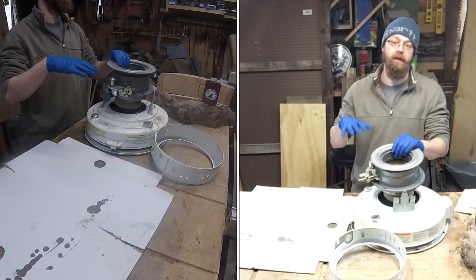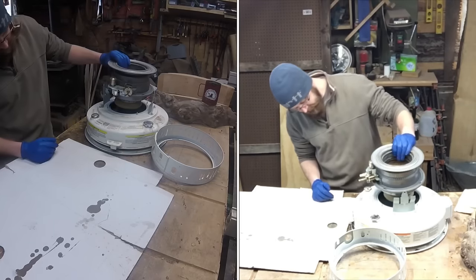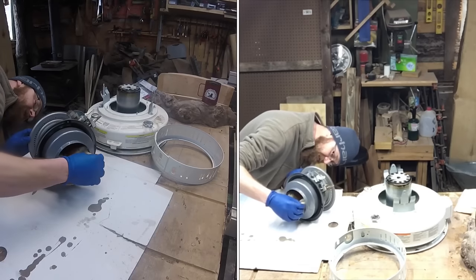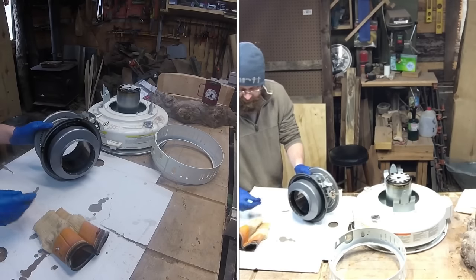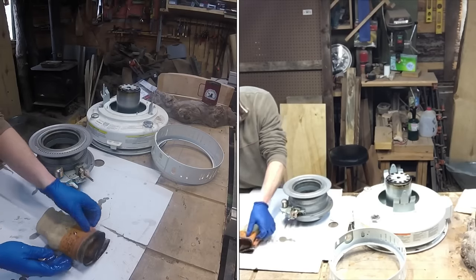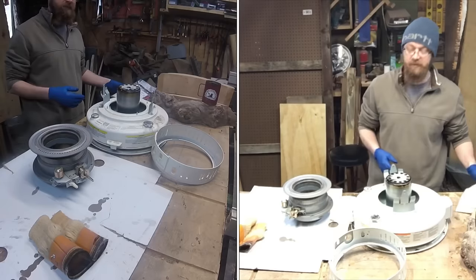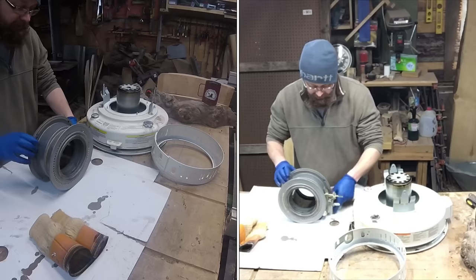Once I get this off I'm going to reach in and fold the wick into itself inside here, then pull it out, put it on the cardboard, and get it right outside my shop — I don't want it leaking on wood and all over my bench. If you can do this outside, I recommend it. I'm only doing it in the shop for better camera angles. We've dripped quite a bit off — pulling this off now. I'll fold the wick down on itself, roll it up and pull it out. Looking it over, it doesn't look too awful bad, but I've had this heater about five years and it's been puffing black smoke, so it's time to replace it.